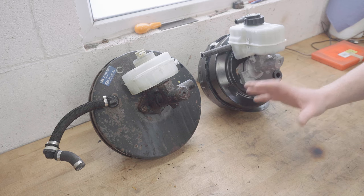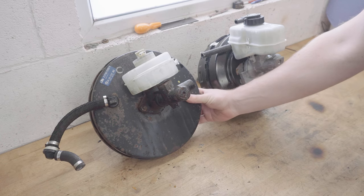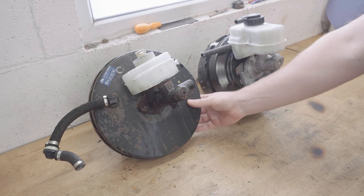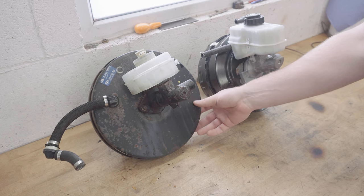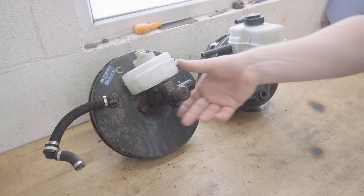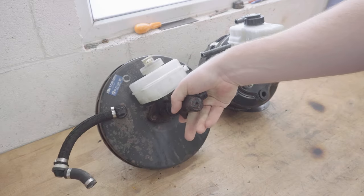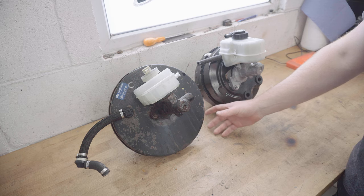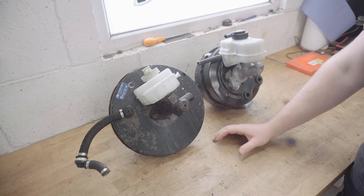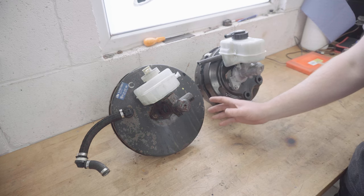The first and most obvious one is to relocate the original brake booster just a little bit to the right, I think by around 2 inches. That involves cutting a bit on the bulkhead, and it's not just as simple as that either, because you would also need to modify the clevis — that's the thing on the other side — because it will be offset when poking into the cabin. Having seen a few descriptions of how that went, it looks like it does work, but you end up in a situation where it's really quite bodgy and there's nasty holes in the firewall, so I decided that probably wasn't the right way to go for me.